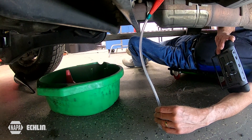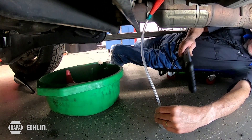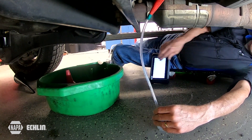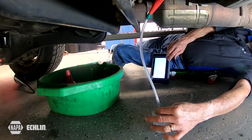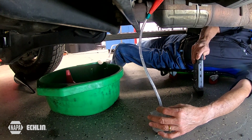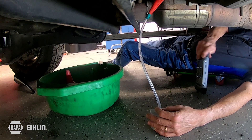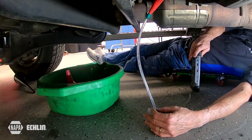This should happen right now — it says I'm good to go. You may be able to hear the pump in the back groaning. This test runs for less than three minutes, and what you'll see is the fluid just kind of drizzling out through the clear plastic tubing. I have a small calibrated beaker that I'm collecting it in. The scan tool spec matches Ford service information verbatim: 40 to 50 milliliters during this time period.